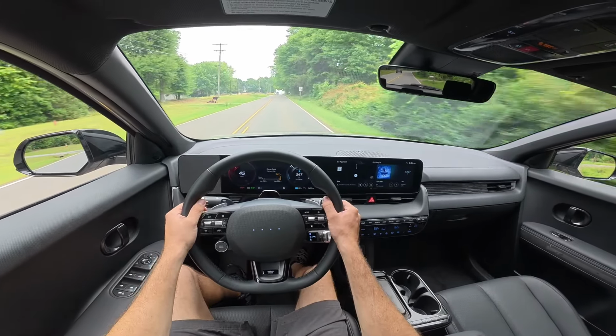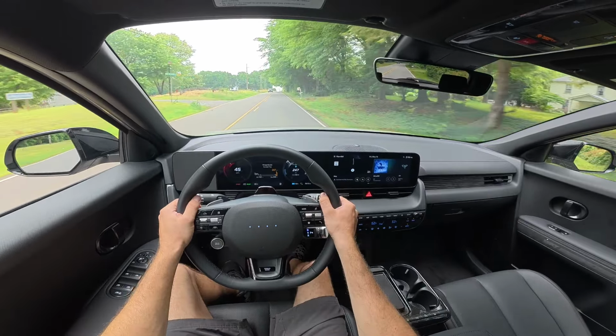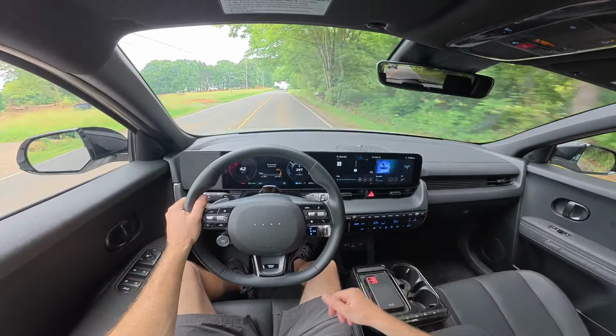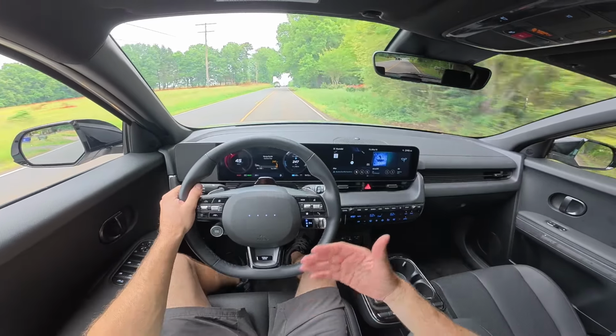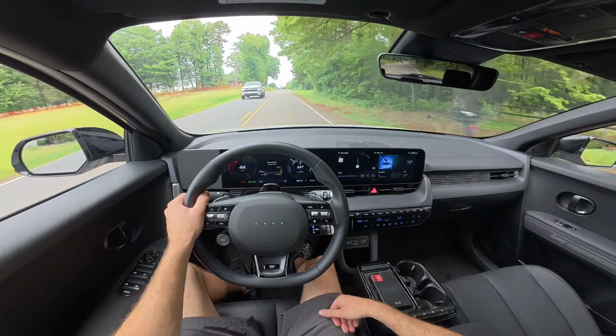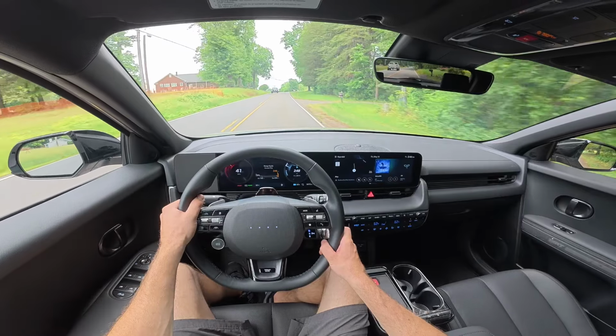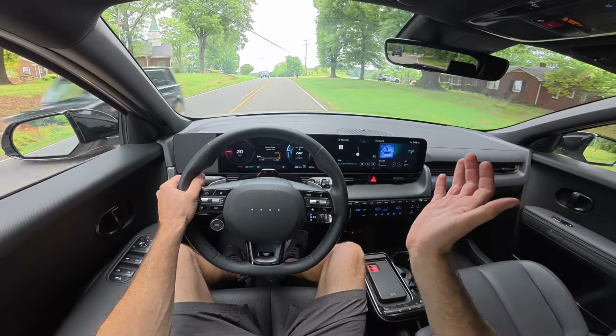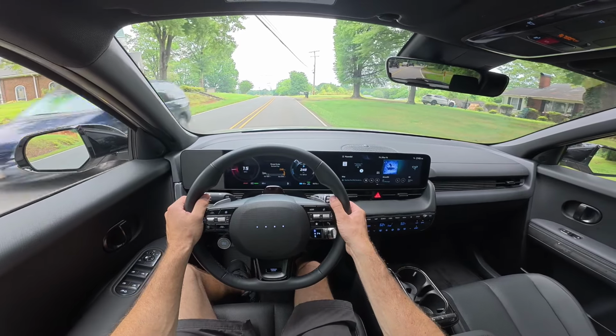And we'll talk about these paddle shifters now. I have it in LV1, which is the lowest setting. Actually, there is 0, so it's completely off. When you let your foot off of the accelerator, you are just going to cruise like you would in a gas vehicle. But as soon as I start going all the way up to 4, or the iPedal Max, I'm not even touching the brake right now, and we're coming almost to a stop.